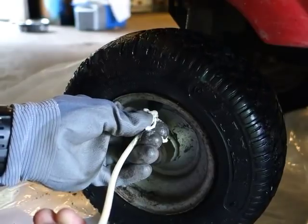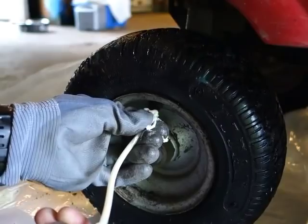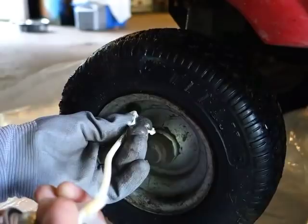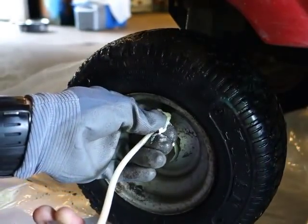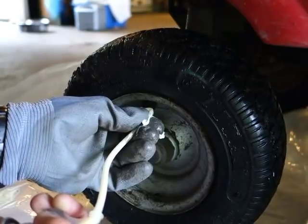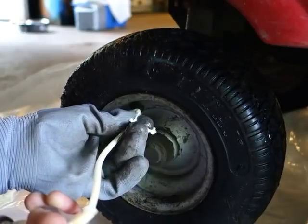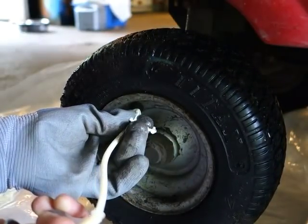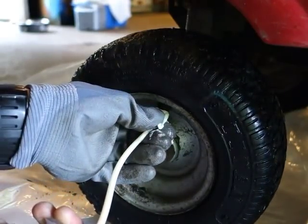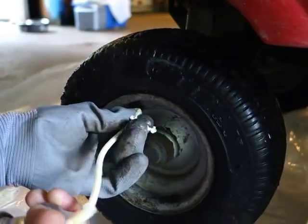One of the guys had a really good tip when he was doing a snowblower tire: keep the valve stem up so as the foam hits on the inside and falls down, it fills in the gaps a little bit more evenly. I'm doing a little rotate back and forth to make sure it fills up the whole area. You don't want any flat spots. For the amount of foam going in and the amount that'll squish out of the holes I drilled, they're going to be just fine. I'm going to wait overnight to let it all cure and seal.